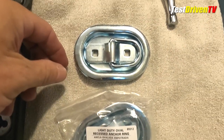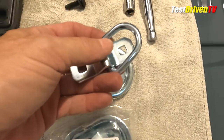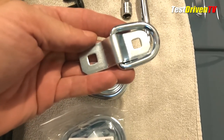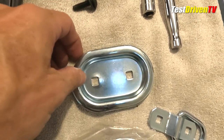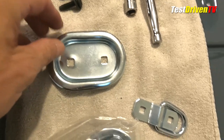The key to the deal is finding a suitable tie-down with a 1.75-inch bolt-to-bolt flange — not easy at all. In my case, I found that Keeper offers a tie-down and flush mount cup set that fits this perfectly. The part number is listed below and you can buy these for about $3 each from a variety of big box retailers online or in store.